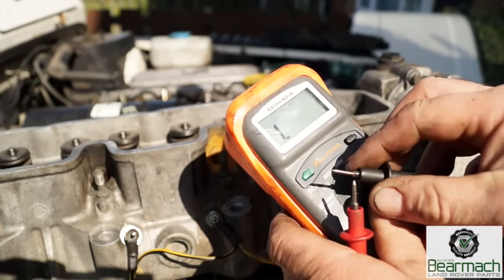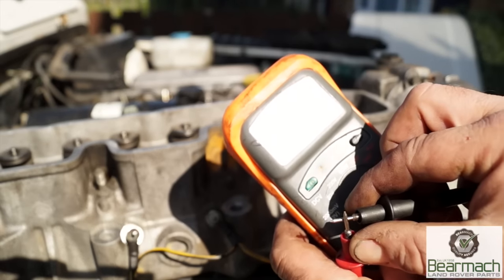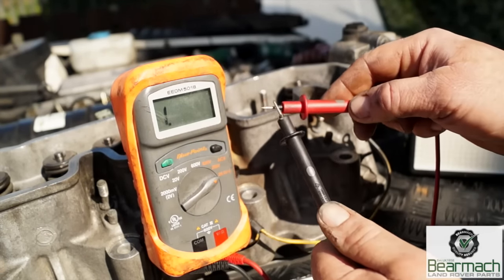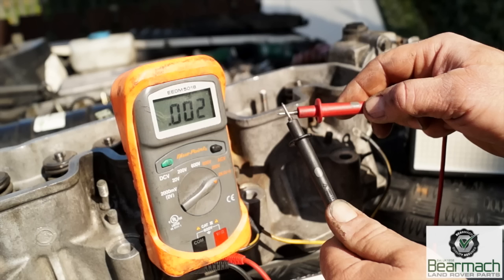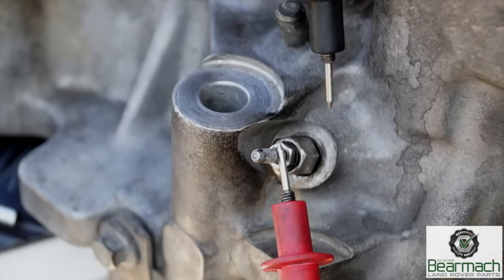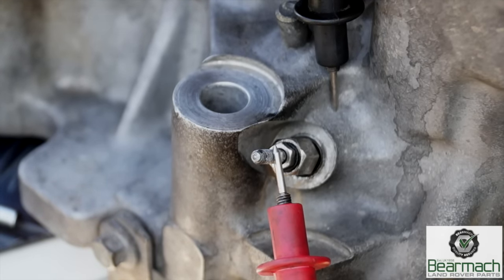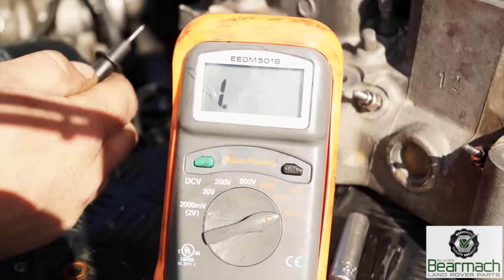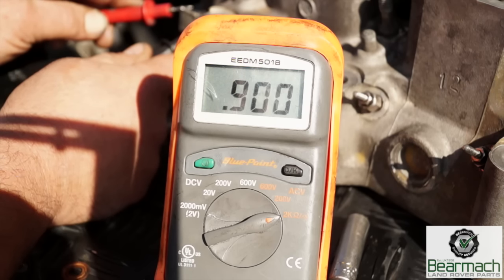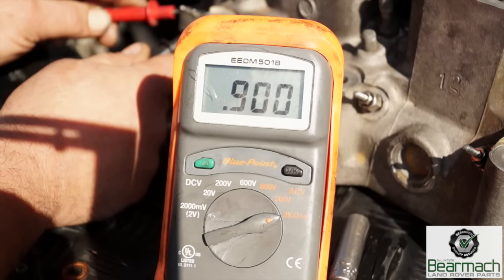I'm going to show you how to check heater plugs. What we need to do is check the resistance on them. I have my multimeter set on resistance — that's 2K or 2,000 ohms. This setting will show us how much resistance we have in the leads before we go ahead and test. This test you can do in between checking any component to make sure you do have a contact. With a glow plug, you put your positive lead on the tip and then the earth to either the engine or the body of the glow plug. So number one is infinite resistance. Checking it out, when we get a reading we have 0.9 ohms — so we have resistance through this glow plug.